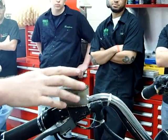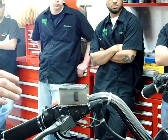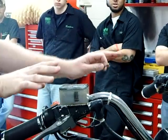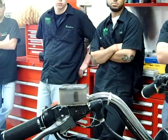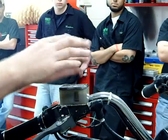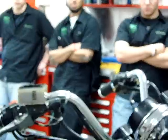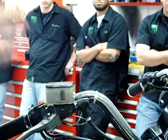Going out and buying a master cylinder isn't so easy, because the master cylinder you go with has to be so dependent on the handlebar angle. If I switch this to a set of drag bars that are straight, this master cylinder is going to sit completely differently. In operation, the top of the master cylinder needs to be pretty close to flat. That was a good example of how to actually remove master cylinder bolts without breaking them and without stripping them.